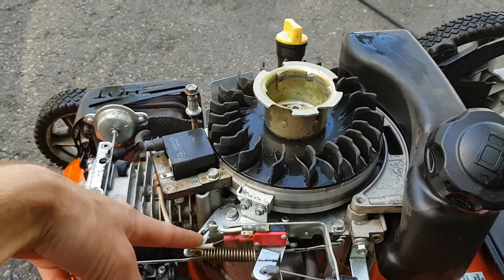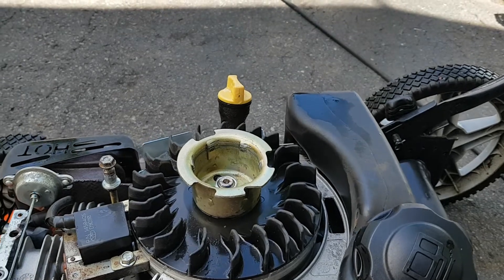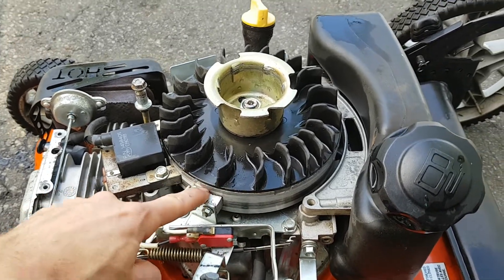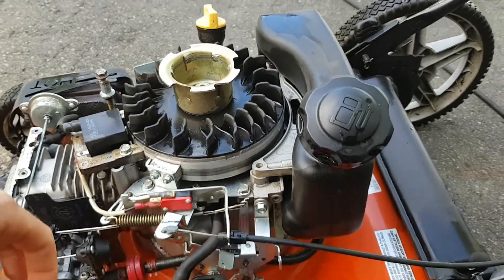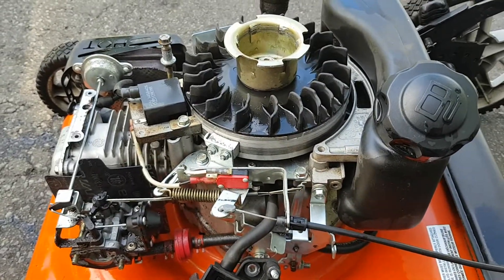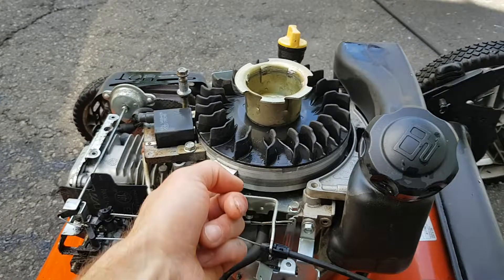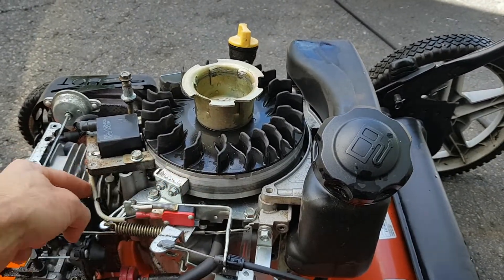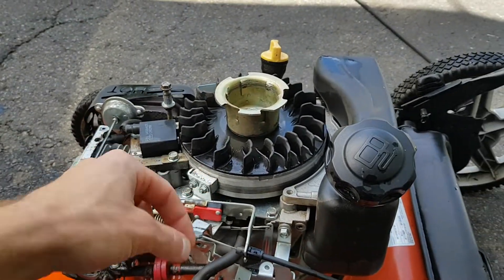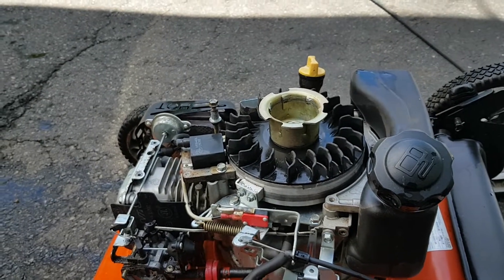Another strange thing about these is the kill wire coming off the coil goes to a switch which is released when you pull back the bail handle brake, and it makes contact with the actual flywheel brake. I've seen these get really nasty and corroded — what happens is you let off the bail handle and the motor just keeps going, or it wants to die but starts up again. Because it's so corroded it's not making good contact to kill the spark. You can start and stop the machine a couple times by depressing and releasing the handle to clean up that layer of corrosion. When they get really bad you have to take the whole thing off and sand it or wire-wheel it.